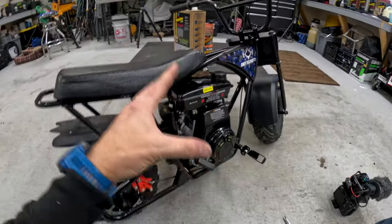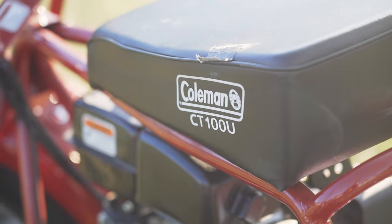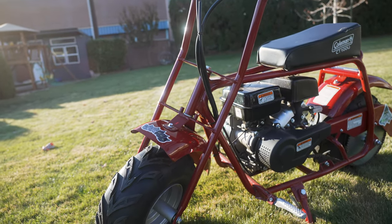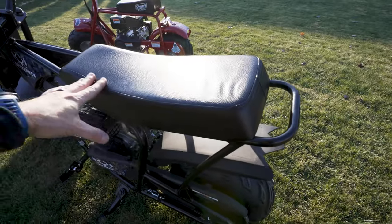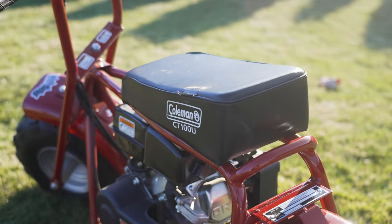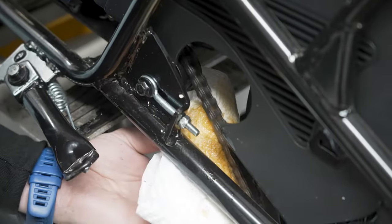The Coleman CT100 is tried and true — pretty much a classic at this point. We've had it for almost four years and it's been great. Comparing the two: first off, I'm a fan of actual separate handlebars on the Oryx — those could be replaced if broken. On the Coleman, the front fork and handlebars are one big piece; if that gets bent, it's dead. The Oryx seat is longer, which is better for taller riders with longer legs. However, the plastic chain guard is something I don't like — it makes it very difficult to lube the chain.